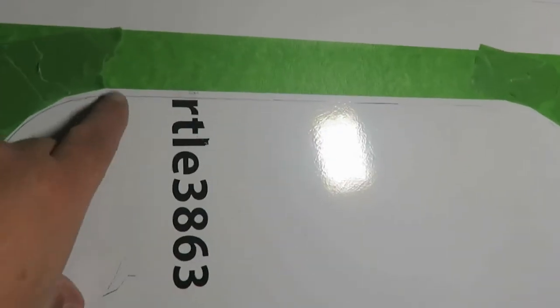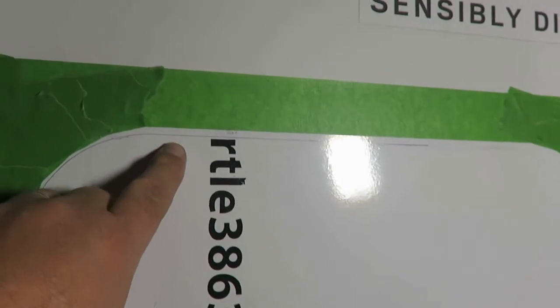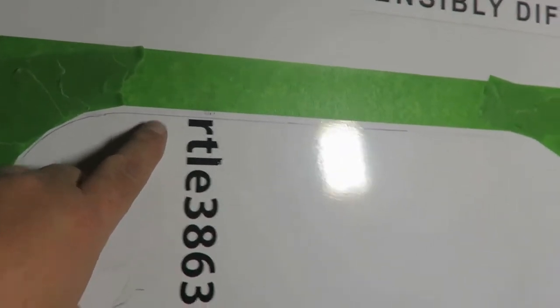One thing you might notice that I did is I also did make this a 1/4 inch bigger than my door opening up on this top. I learned that last time. The reason why is they have rivets put in here and they protrude up, and it causes you to have a hard time getting those in. So it just gives you a little extra room to play with. You want it tight, but you want to be able not to have to force that in there.